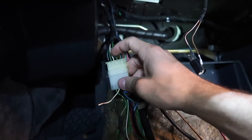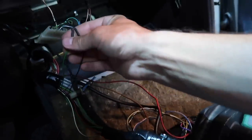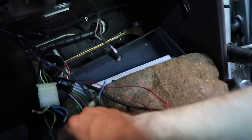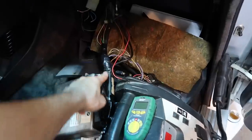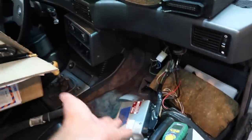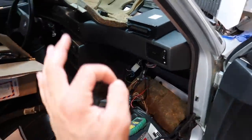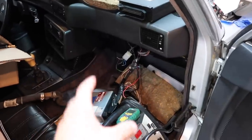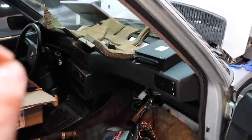This is where you're getting your stuff from in conjunction with this. Well, this information has to go to the ECU. Look at the way I did it. The information from the E28 is going into the engine harness, which is going to the cut connectors over there, which aren't doing anything. So I'm supposed to tie them into this side, the ECU side, obviously. So I'm going to switch around my wiring here, and I'm likely to bet that we will have power restored to the ECU, meaning we will actually have function in the engine bay.